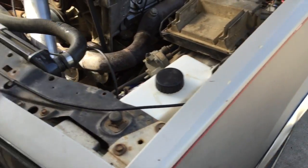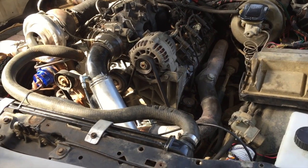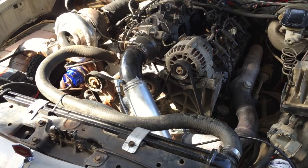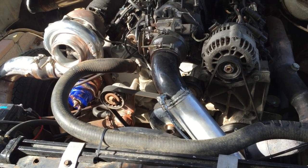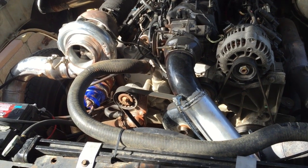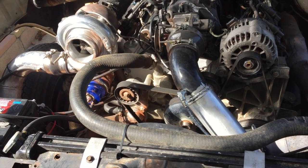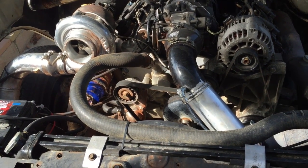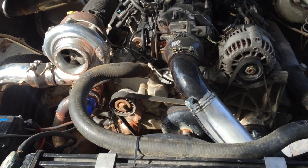It was last Friday, and so the night before, my buddy Toma was like, I think I got the dyno working, come by and we'll give it a try. So throw it on the dyno, drive all the way out to his house. It's about 20-30 miles away. Everything goes good. Put it on the dyno, do a couple pulls. Air fuel's good. We turn it up. Air fuel, the VE starts going away. Like, it got 120% duty cycle and all that kind of stuff.